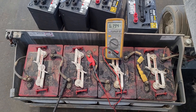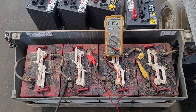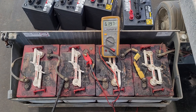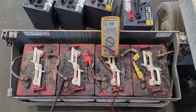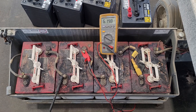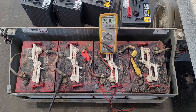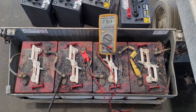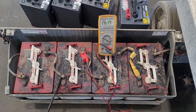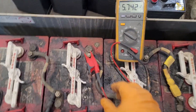I don't want to see anything below 4.9 volts — really below 5 — but 4.9 is the threshold given for a 6-volt battery. So let's deadhead this. It should hold a 15-second load, and it is not. I've got 2.6 volts after just five seconds.